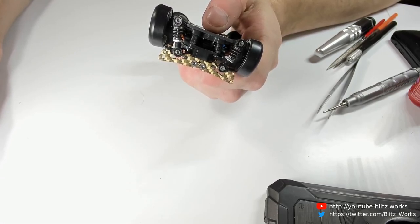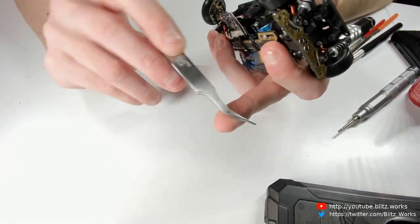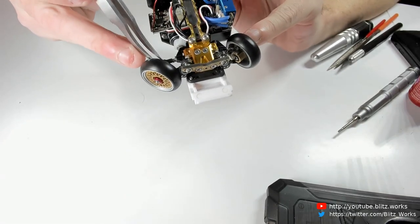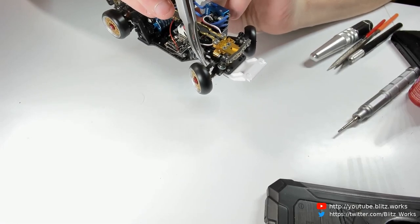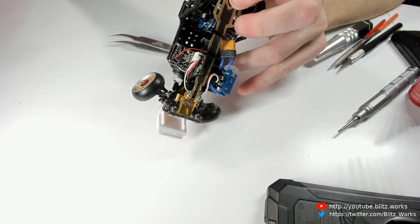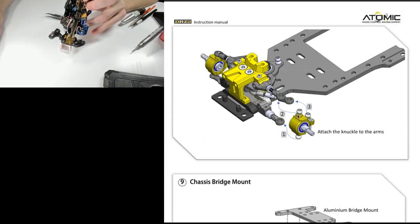This step is pretty simple — just make sure you don't over-push the ball heads onto there and have them resting against the brass bit. If you do, this is where tweezers with a bent head work really well — you force it underneath the ball cup and lean it back, and it will just pop it up. Literally put the tweezers underneath the ball cup, force it down, and it pops up.